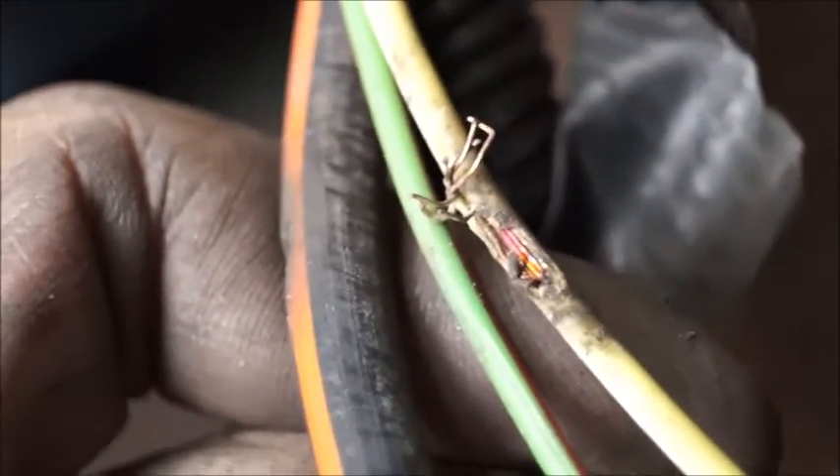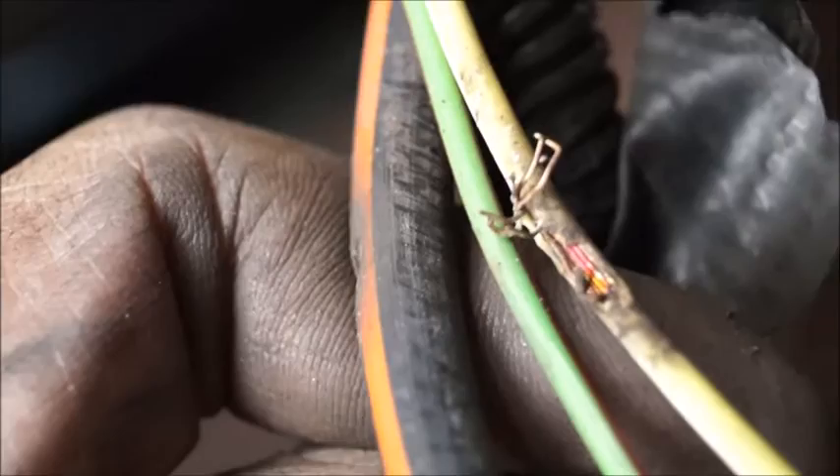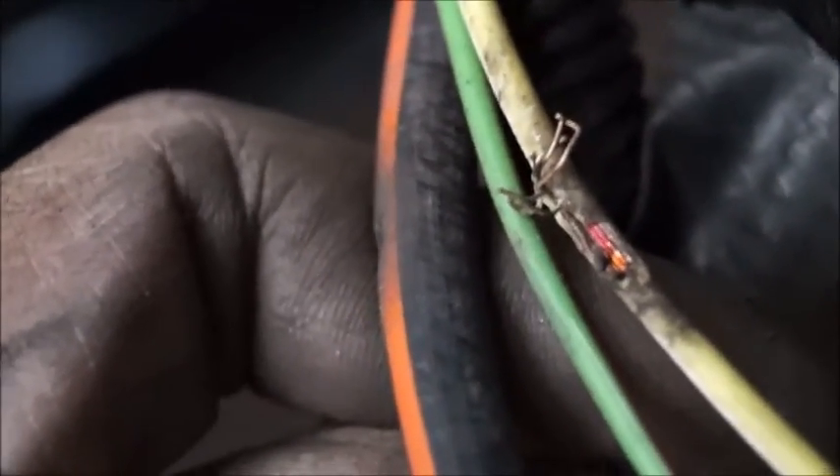There's a better shot — you can see the yellow wire was melted and stripped apart. I'm not sure exactly which one the yellow wire is, but if I had to guess, I'd figure it's the one that goes to the alternator. So we're going to repair that and see if that fixes our problem.